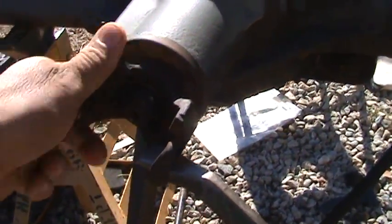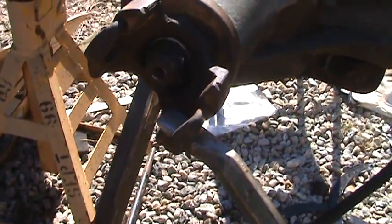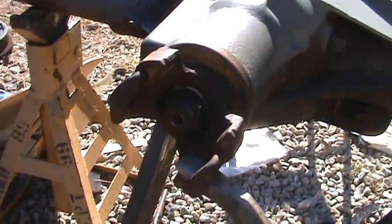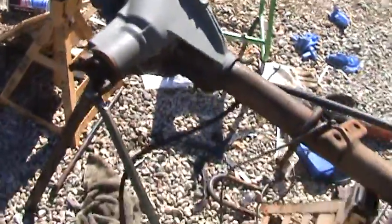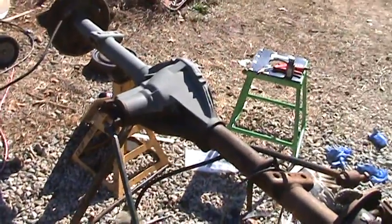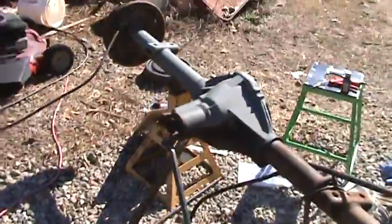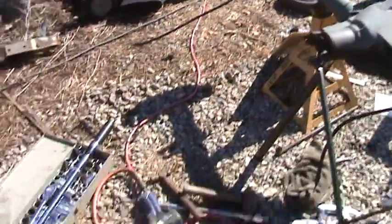I had a little bit too much lash left in there, so I got off the torque wrench and checked everything. We're fixing to put it to it, but I just wanted to reiterate on that a little bit, because that is very, very important. If you don't get them things back tight, you're gonna tear up some stuff, make a bunch of racket — and that's what we're trying to avoid.